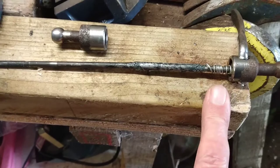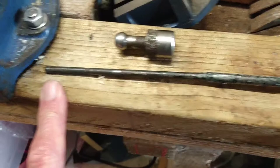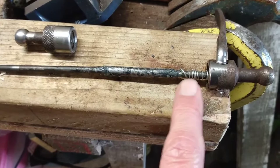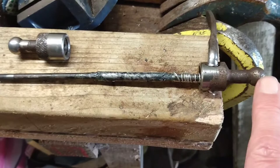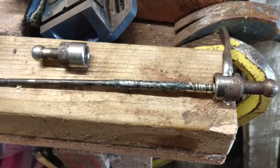What I've just realized when fitting it is that it's a snug fit through the hex key end of the through-bolt axle, but it was a loose fit at the other end. Any strain on there — without needing to over-tighten — is going to be flexing it up and down, because this moves inside the end of the axle. I didn't want that, so I've wound a piece of wire around there.